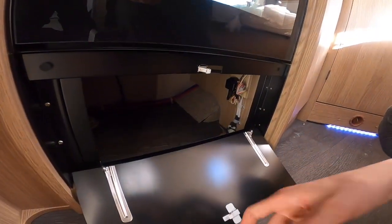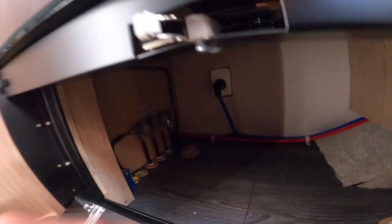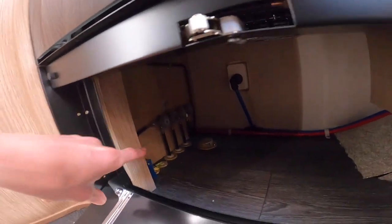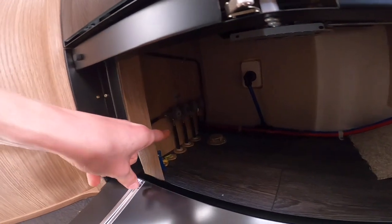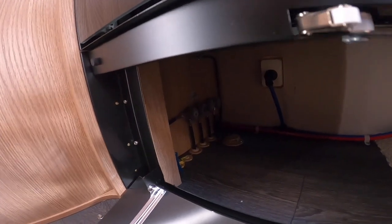You may just want to take your grill pan out when travelling or wrap it up in a tea towel, and the same with the oven shelf — but always make sure the oven shelf goes back in with the lugs at the back, as it's designed to stop the burner jet for the oven being blocked. You've got your oven there. Underneath is where you'll find storage but also the plug for your electric hot plate, and anti-gas taps which are mainly for when the vehicle is habitation-serviced yearly. Any problems with gas, you can turn the bottle off to be safe, but you can also isolate each appliance there.